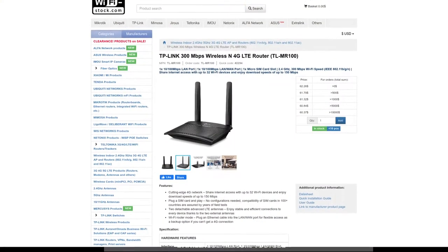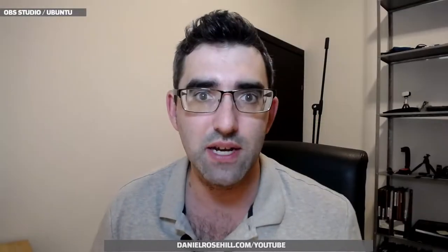So what I've learned: it takes roughly 40-45 seconds from when your primary internet goes down for the TP-Link device to bring in the cellular backup line. And when your primary comes back, on this particular configuration — my ISP, my cellular, and the TP-Link TL-MR100 300 Mbps router — it took approximately a little over a minute to provision the ISP line back. So it actually took slightly longer to fail back than to fail over. Anyway, that was the test — I hope this video was interesting. Feel free to subscribe!